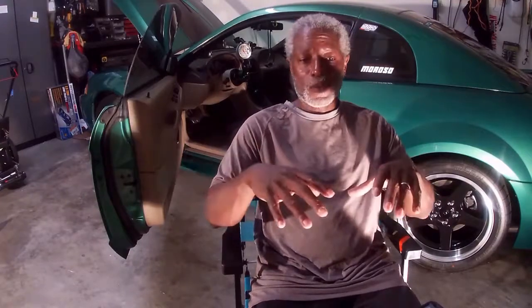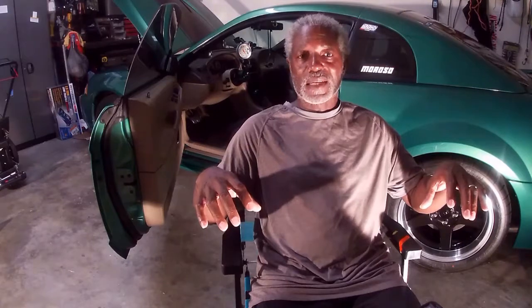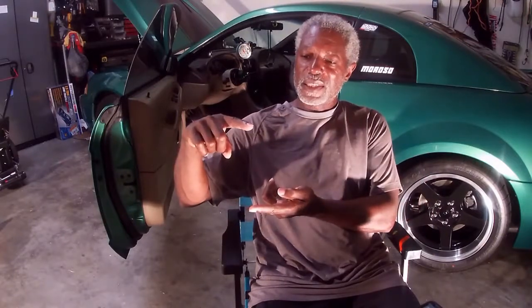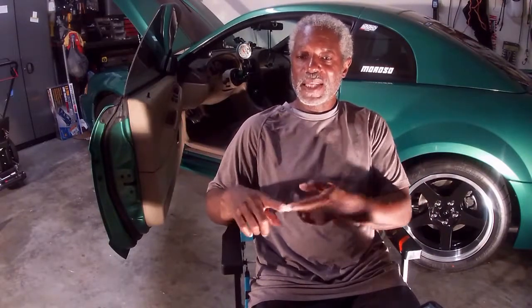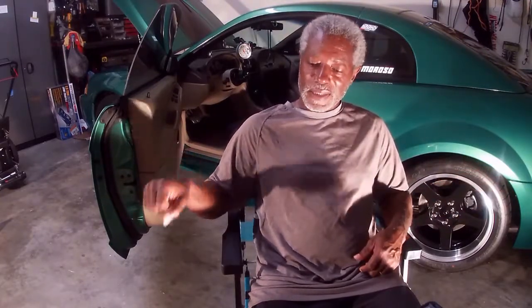But when you get everything out of the way, now my 29-inch Daytona jack with the cross member bar has a piece on it. It's just like a lift at a shop. You can slide them out, and they've got rubber mounts on each of them, and they're about that big around. And then you can twist them up about maybe 6 to 8 inches, or you can keep them down flat. And with that support under there, I was able to jack that up underneath to support the K-member,